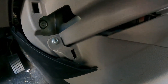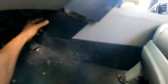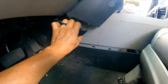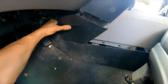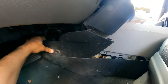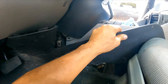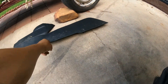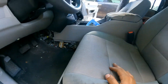That was the bolt we were after. Next we're going to remove this cover on both sides of the vehicle — this one's pretty easy, it's going to pop just like that. Make sure it's loose. You can bend this part a little — no big deal — still don't force it. Then place it face up so it doesn't get scratched.